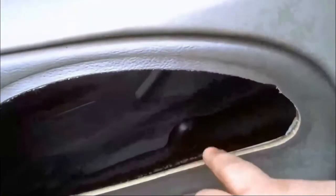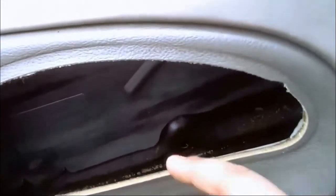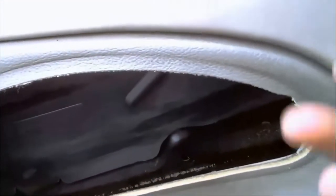When you take this off, use a flathead screwdriver. When the panel is in the door, there's gonna be a tab on each side. From the outside, you put your screwdriver just in the crevice just right and it pops out the clip. You gotta do that for each side. I would show you but I already took it apart, so it's too late for that.